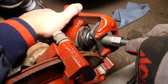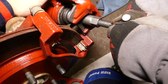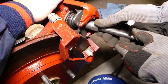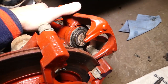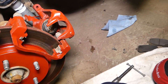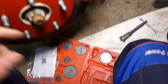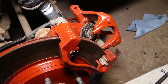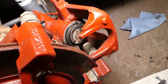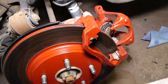You can see the piston goes in all the way — so much easier that way. Now all we have to do is get it loose. I forgot to mention that on this vehicle we had to use the right-hand side tool instead of the left-hand side — we switched because it's clockwise. Some are counterclockwise; this one goes clockwise, so we used the right-hand side tool. The caliper piston is all the way in — that's how you compress the piston. Thank you for watching, please subscribe, and see you next time.